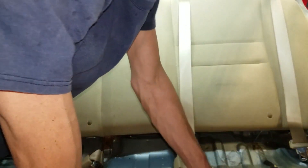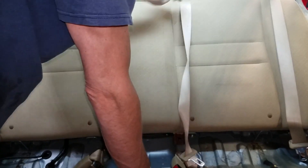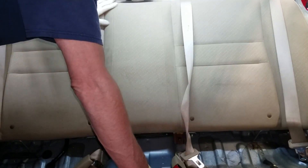I already went ahead and pulled the lower seat — that one basically just side clips in, you just got to give it a real good tug and it'll pop out. There's a couple 10 millimeter bolts down here below underneath the seat, and then we're going to have to push it up to unclip the clips in the back of the seat so we'll be able to pull this thing out.